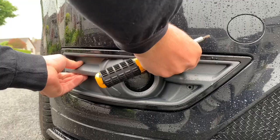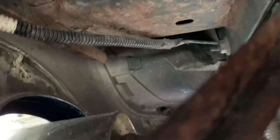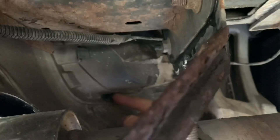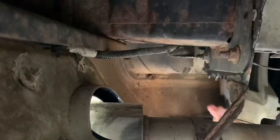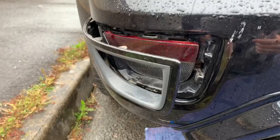For the rears you're going to have to get underneath the car - there'll be some tabs you've got to push in. When you're underneath, push this tab in that way, and this little tab here which is quite tight - you've got to push this little triangle up and in and then it will unclip from the other side. Sometimes you might have to use a little flat-head screwdriver to push this bit in, and then on the other side simply pull it out.